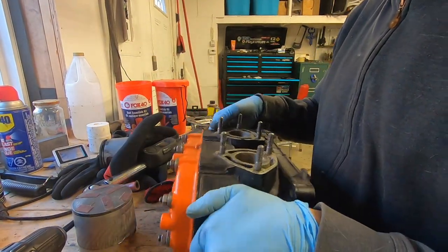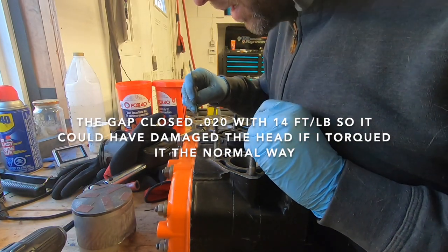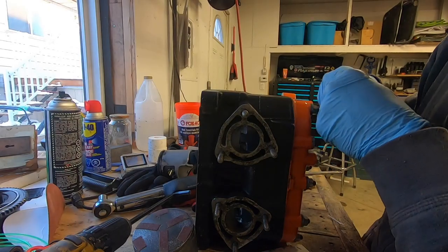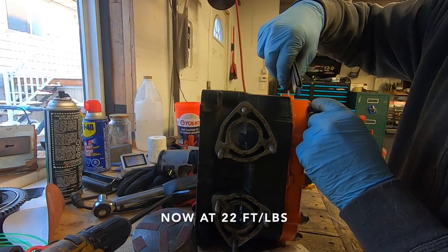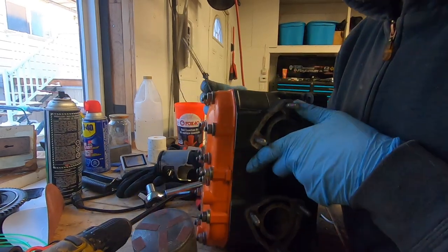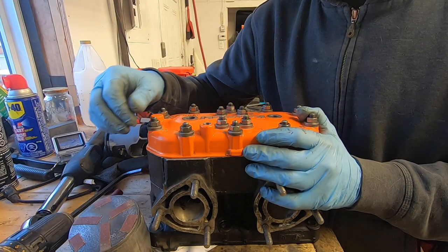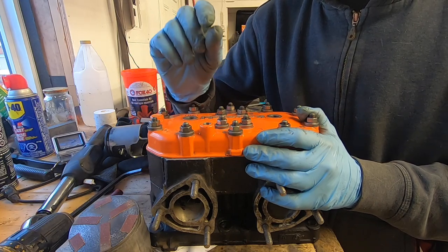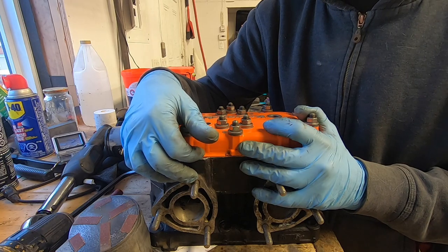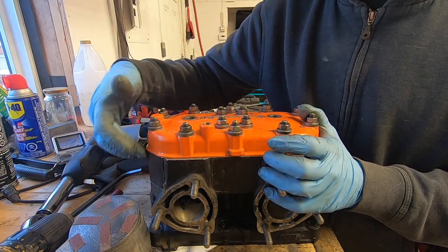Now I'm going to check the clearance and show you guys why I didn't just tighten it all down in one go. The reason is I now have 14 thousandths. On this side we've got about 5 thousandths, and over on this side we have almost nothing. I was worried that the copper o-ring might actually be a little bit too thick or be protruding a little bit too far out of the head, causing a gap around the water jackets that I wouldn't be able to seal. I've torqued the head down and verified that there's not going to be any huge gaps.